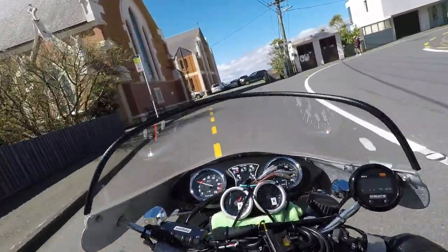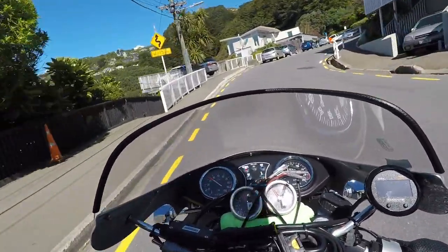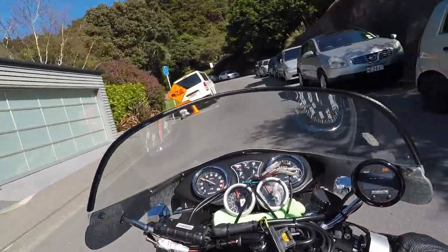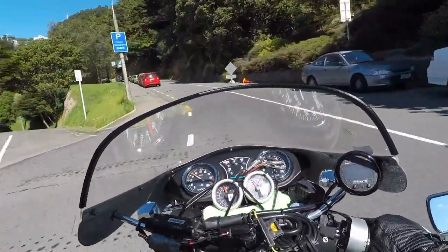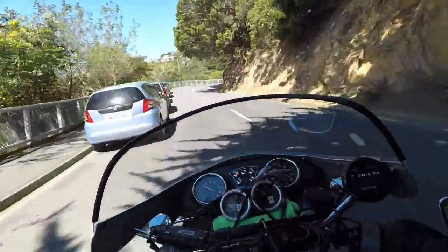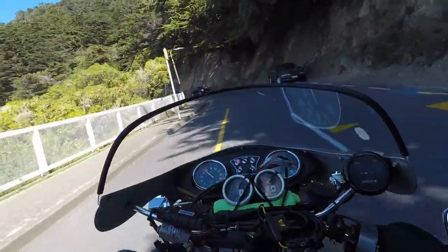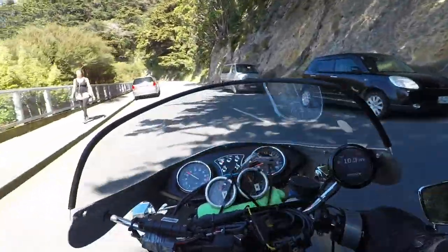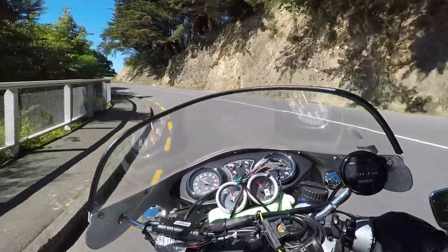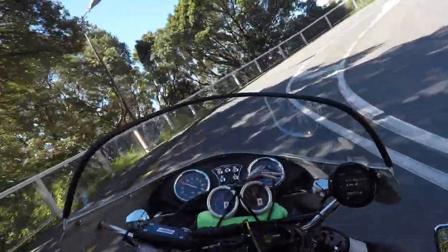Temperature's on. Needles go up, go down, and then they go up. Oh, look at that. About 54, 55. Gotta watch I don't get distracted. The sound of the exhaust is terrible. So 10.8, 10.6. This is with the throttle at this position, halfway, say between the second and third mark, which is often where it is when I'm riding. If I go up to the first mark, that's there, 10.6, 10.5. Well, if we thought it ran rich, we can see it. It certainly is.